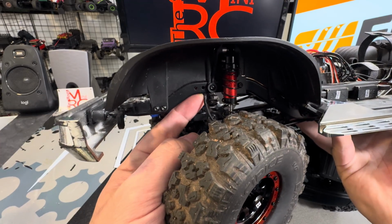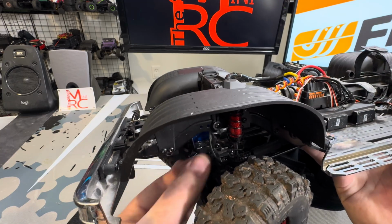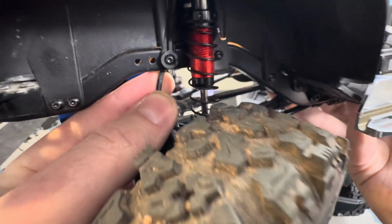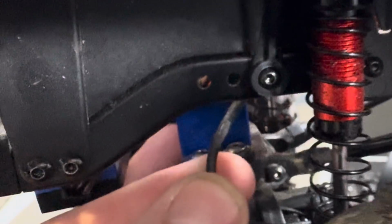The inside of the chassis rail here rubs, and you can eventually rub through that line and hit the braided portion, or you know, the metal sleeve. You can kind of see it. It's really hard to see, but there you go. But it's in there and it's rubbed, and you can actually see the metal sleeving inside there just from it rubbing on the chassis. So awesome that they rerouted that. That's a good thing for sure.